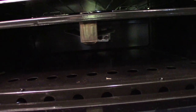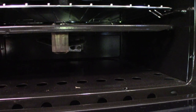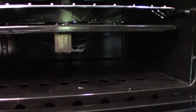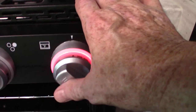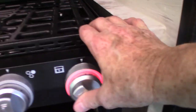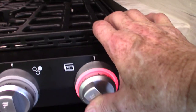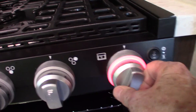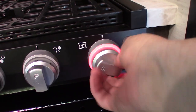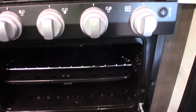The oven is a little different. All the way to the back at the bottom is a pilot light — you can see it sparking back there. What you do is go to the oven knob, which is all the way to the right, turn it to the picture of the flame for pilot light, then depress and hold it, then spark this clockwise until you see it light at the bottom. After it lights, hold the knob for another 10 seconds to heat up the thermocouple, then go to operating temperature. When you shut the oven off the pilot light goes out too, so you have to relight it each time you use the oven.